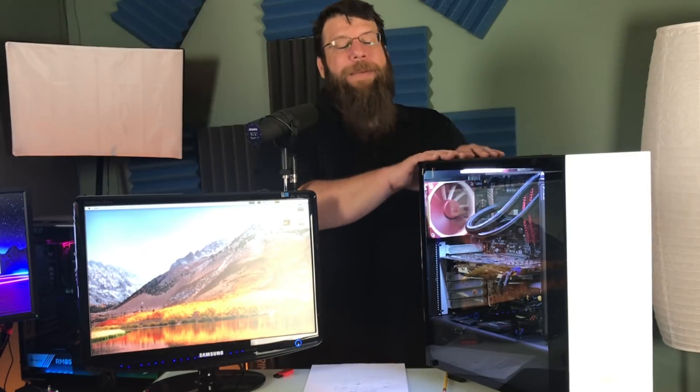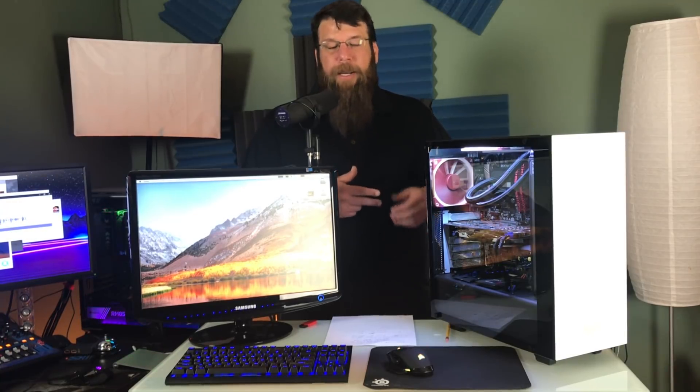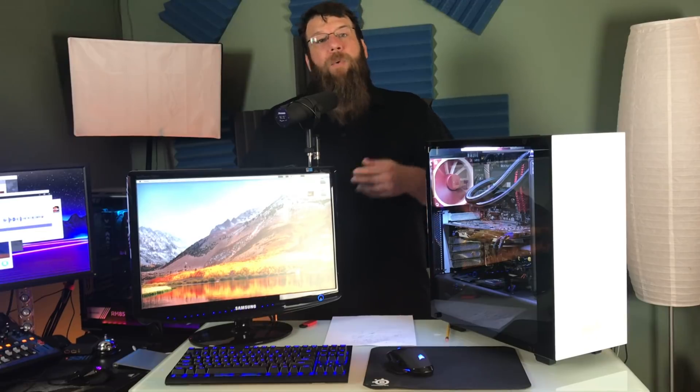I'd love to see Apple start making desktops again. Until that point, a solution like this makes a lot of sense for somebody who's really addicted to Mac OS X. Aside from the USB 3 ports not working, everything else works fine. It wasn't an easy process — it took time to get the graphics card working, the iGPU working, Final Cut working, and even getting the NIC card to work took a little time. But once I was there, everything works great, and it only took about 24 hours to figure it all out.